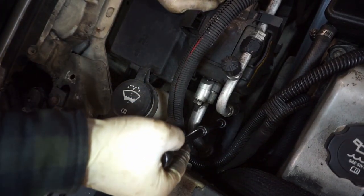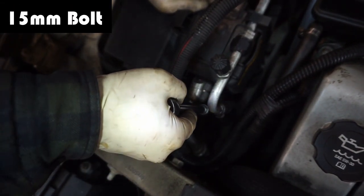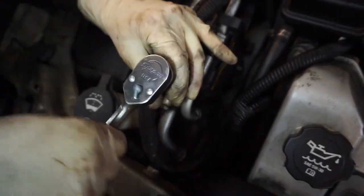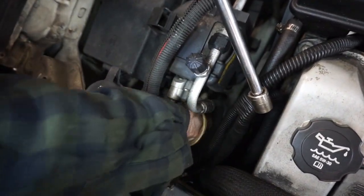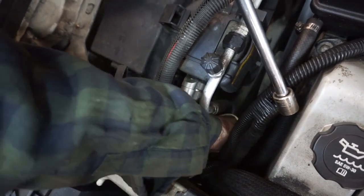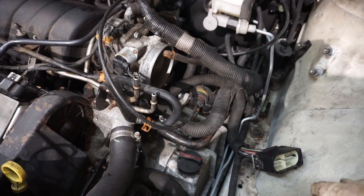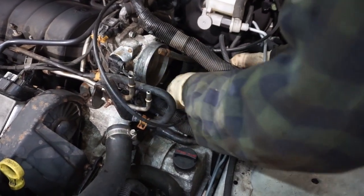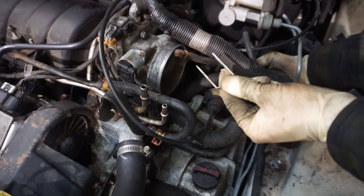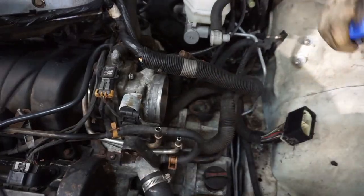Next up, we're going to remove the passenger side engine ground here — it's right on the body of the frame. This is a 15mm bolt and we're just going to loosen it and get rid of it. To get the shift control cable out, there's a little clip right here that you have to pop out. There's our shift cable. In order to get it out of that bracket, you have to squeeze on these — they're a bit stiff and it lines up with this key right there in the hole.